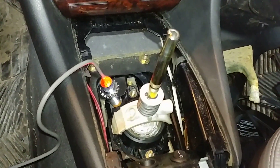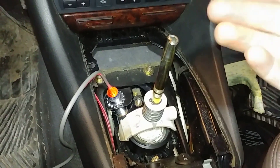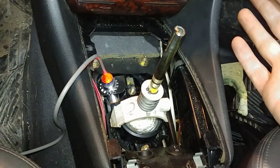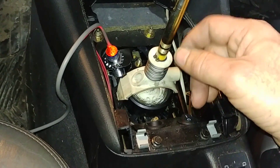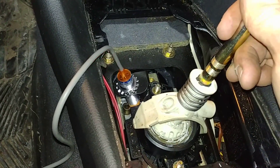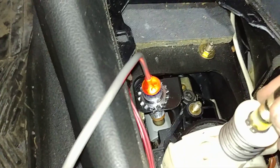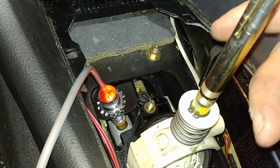In the past I used to install remote starters all the time, back in the 90s and early 2000s. We didn't have this kind of technology easily available. So I got a proximity switch setup — this will work on any Audi from the mid-90s right up to current cars with manual transmission. I've got the proximity switch sitting just above the shift selector fork. As you can see down there, there's a socket head cap screw, and as I move it into any gear, the light on this proximity sensor shuts off.